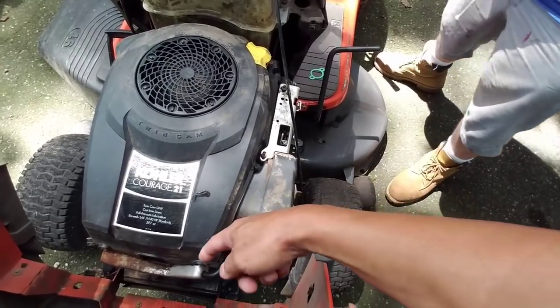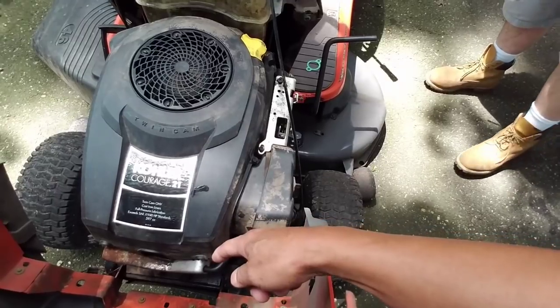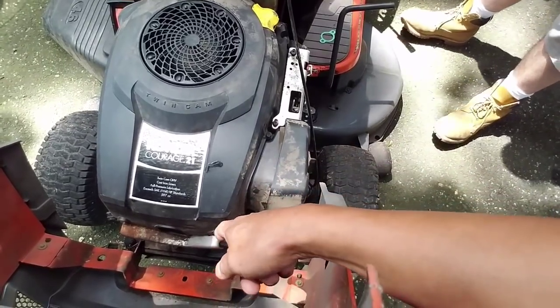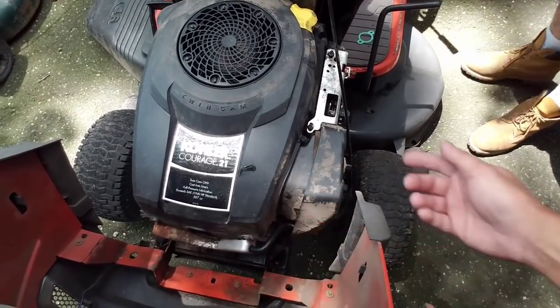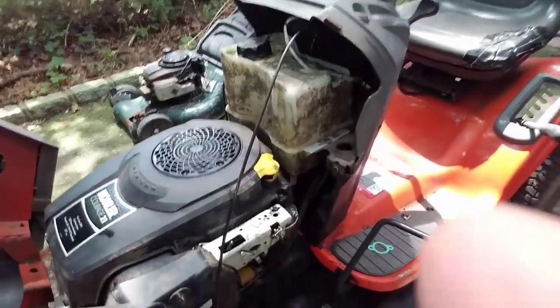They've got a two-layer valve cover. On the bottom of that second layer is like a wick, and it soaks up the oil that's in there and just stays there. That's why it goes bad, and it's always on the bottom. So you always want to wring that out when you change it. But anyway, he said his motor's blown.